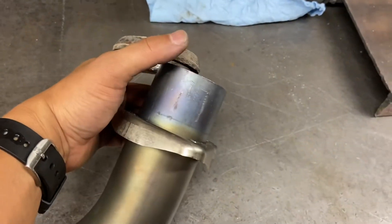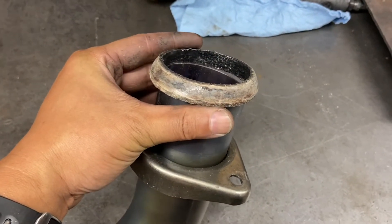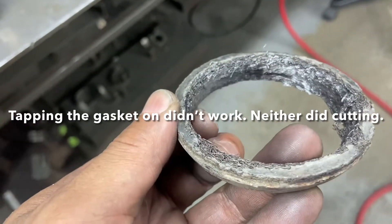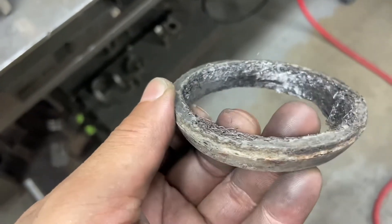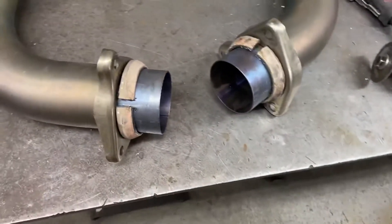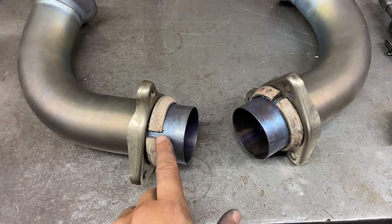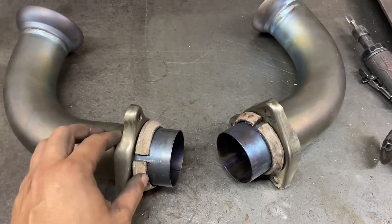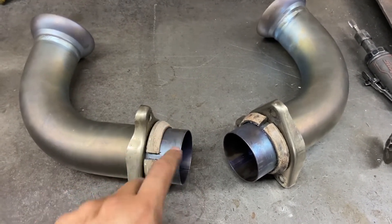Since this pipe is bigger, I do have to tap the gasket on it with a hammer to expand it enough. I tried cutting the ID of the gasket to be bigger, but once I got through the first layer it's all stainless steel wire inside — these gaskets are really tough, much tougher than they look. So what I did was cut a slit in a spare gasket to go over the pipe. I'm not worried about exhaust gas leaking because once you put the flange on, the gasket more or less just keeps the pipe from rattling inside the muffler.